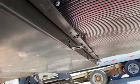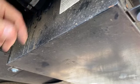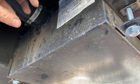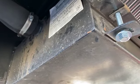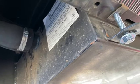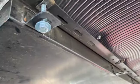So that will give me a little more drop so the fuel comes in at a better downhill angle and flows in better. Back to that ball — it was stuck. My assumption is that since we didn't use it much, especially during the hot summer, the ball and the gas kind of lacquered up or got sticky, and it stuck to the top and didn't push out like it should have. When I took this off and slid it out I could look all the way through the tube, saw it was stuck, pushed on it, and it popped free.